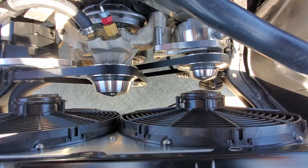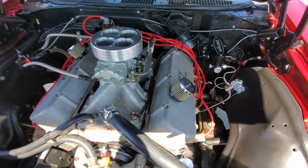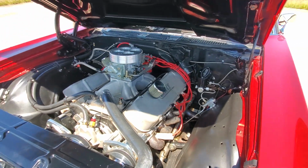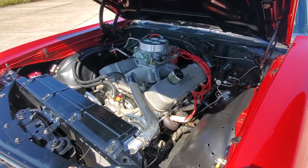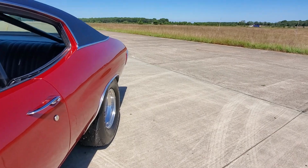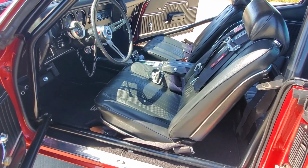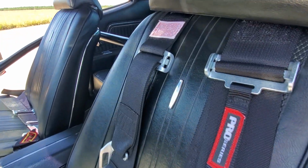They're like 30. Oh no, this radiator is off the hook. This car goes up to 185 and will drop down to 168, 170. It's just because the radiator is cooling it out. Wow, killer. And running on corn, that's another thing. The motor runs cool. Corn helps versus race gas. The pistons in this thing are 13-1, and you're running on E85. And you're paying $1.80 a gallon versus paying $10 a gallon for race fuel.